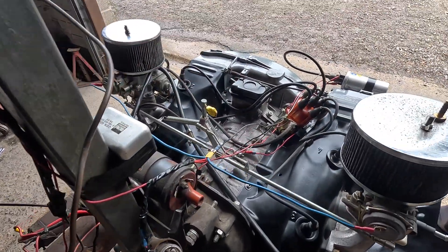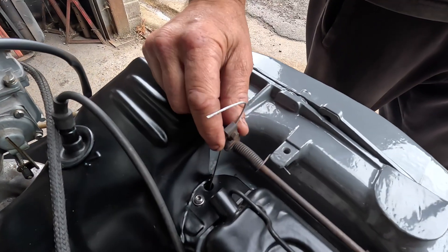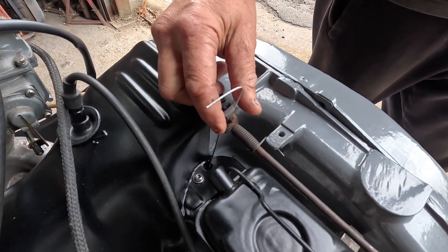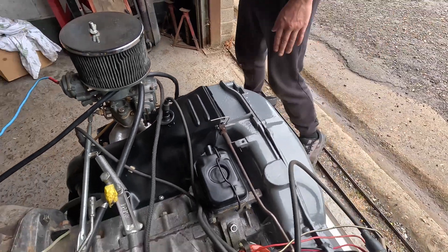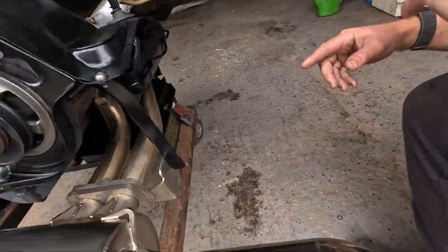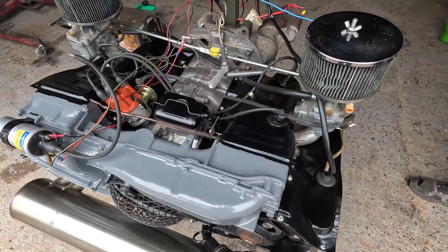You can see the linked chokes — the flaps are obviously still installed on this. I've put a new cable in, and we'll check that it's fully returning out and making sure the flaps will be off when it's warm on the thermostat underneath. That cable will let out and this will pull back and open the flaps up.